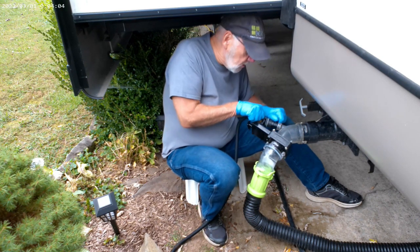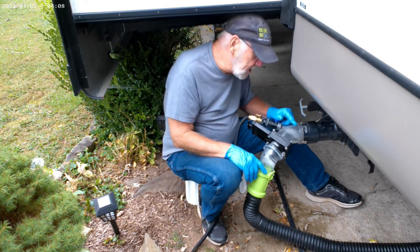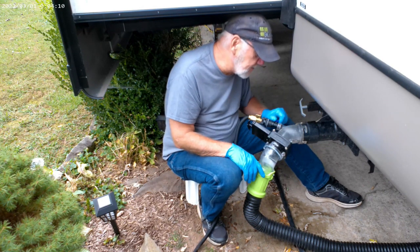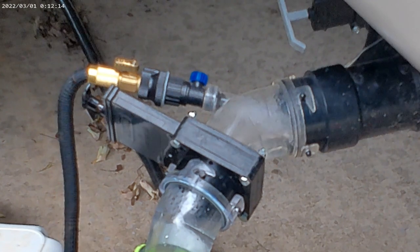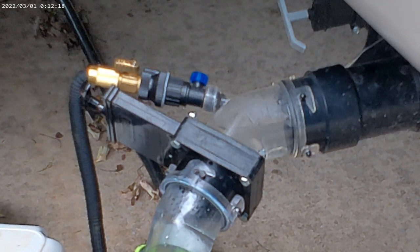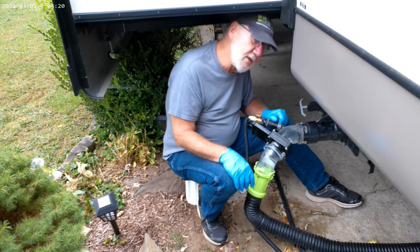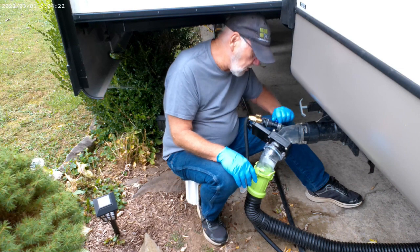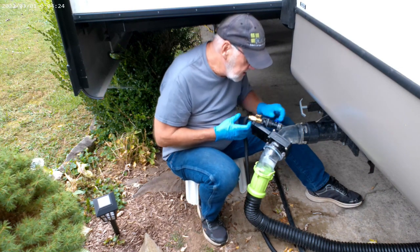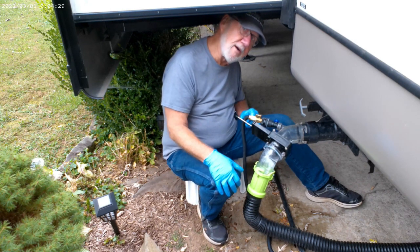So what you do is turn on the water. There's another valve right in here to clean. Watch until your hose fills up very carefully and listen. When it gets up to the clog, it'll just take a few more seconds and the water pressure will blow it out — you'll hear it make a big burp and a gurgle. When you hear that gurgle, go ahead and turn the water off. Open this valve and everything should come out.